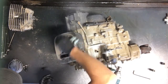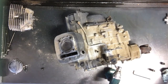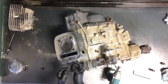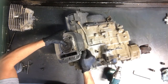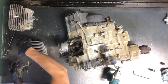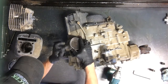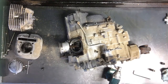Next we'll pull this cylinder. You can see a little corrosion there, but the dome of that doesn't look bad — there might be some buildup on there. We'll pull this allen down here, which is the only thing holding this besides the head bolts that came out of the top. Pull that allen, then this cylinder will be ready to come off — piston drops down in there and you'll have to work it back and forth, there's a gasket there that'll kind of hold everything together. There is the cylinder — check scoring on those walls, check the piston. The piston has some buildup, could be cleaned up, possibly new rings, and it might be in good condition.